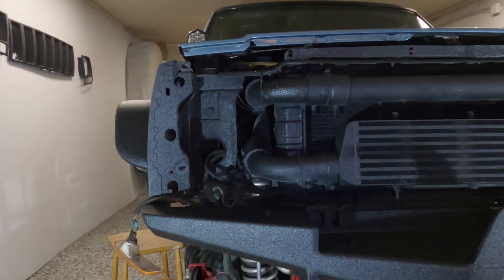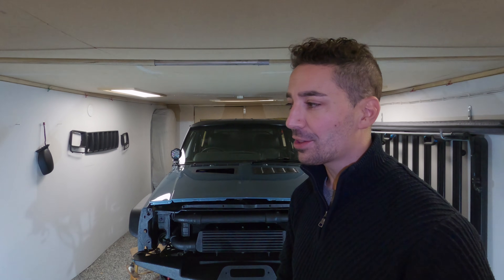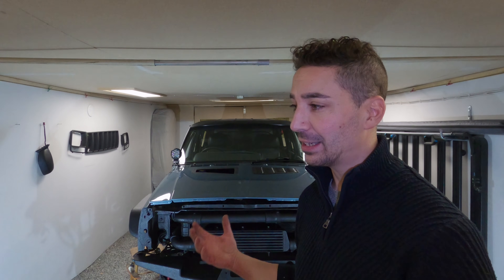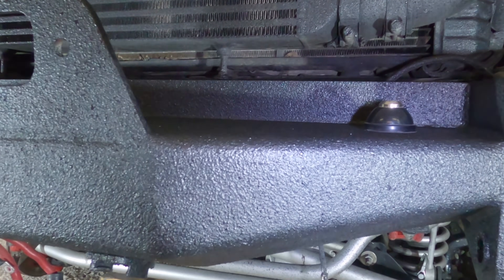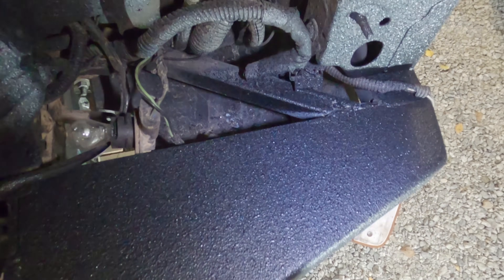That's all the painting done and the car has actually been sitting in the garage for about seven days since I last sprayed it with the Raptor liner. Some references say 21 days to cure; most say within about a week to be able to use it for hard stuff. I think if you're going to do a truck bed with it and start chucking machines and logs in the back, I would give it like two weeks in warm temperatures before really beating on it, or else it's going to start to come off and be a bit soft. Let's take a look at the vehicle and the finished results. The bumper came out real nice, nice texture, compressor maintained 60 psi the whole way.